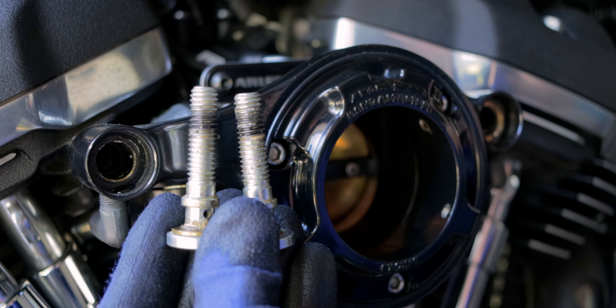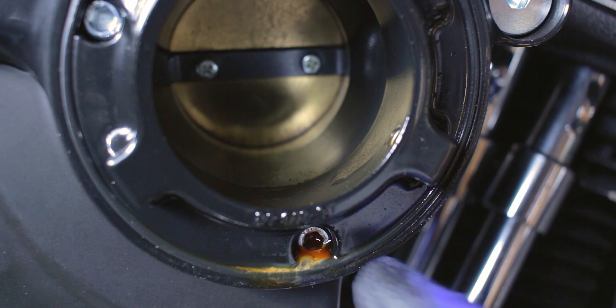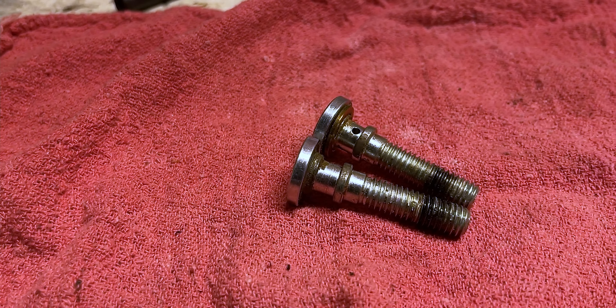Where does that leave me? I'm going to gather more data. I've reversed the Arlen Ness external breather modification but I'm leaving the crankcase ventilation solution in place. I'm going to ride it for a while and remove those intake bolts periodically to check them for residue, because I want to make sure I don't get additional oil buildup — which is the whole point of all of these projects: to minimize or eliminate the blow-by and avoid blowing oil into the intake where it collects on top of the pistons. I'll post a follow-up video to share the results and any additional information on testing for crankcase vacuum.